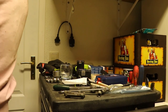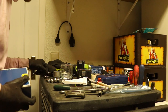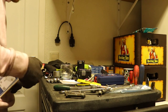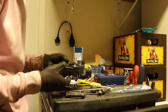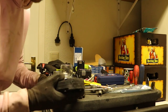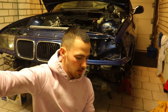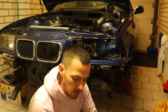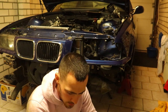I just tightened all the bolts that need to be tightened except one, but we'll sort that out another day. Everything that should be tight is tight. What we are going to do now is install the little donut piece. Mine was starting to crack a little, so we are going to go for a new one since we're already at it — three bolts and hook it up to the transmission. Thanks Mark for cleaning this up real nice. He helped me with the removal of the transmission and the seals. So we're going to put this back in, and that means the transmission is fully back in.